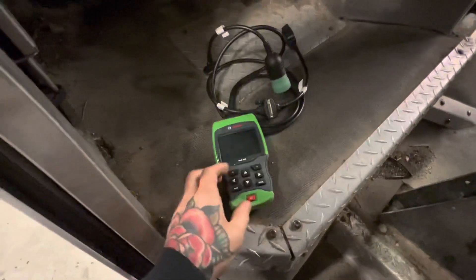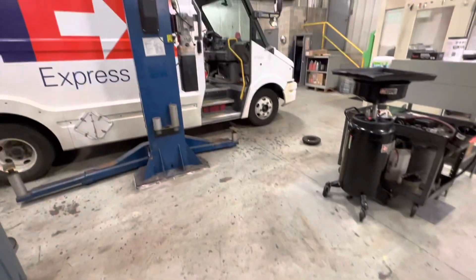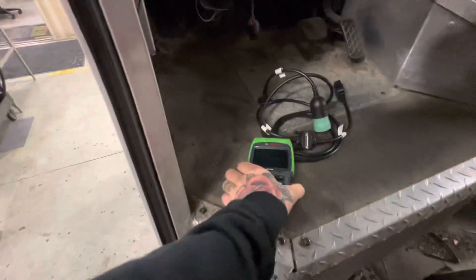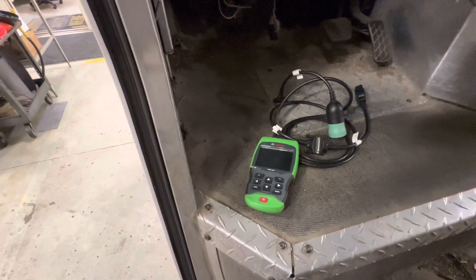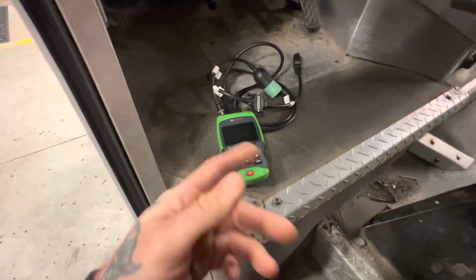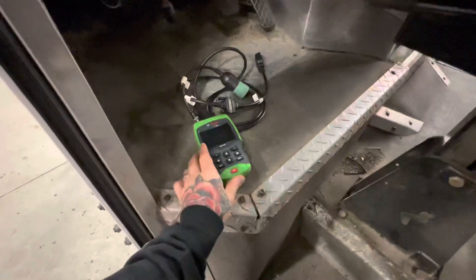It's not going to do everything — it's not going to do regens or give you everything you want — but what I like about this is on mornings like today, when I get here I only have a few hours to get a game plan for the day and pick what I'm going to pull out of service. This truck had an exhaust light on, and I was quickly able to use this tool to check it out and realize I'm going to have to pull it for service and order parts. I do have the factory tool for the Isuzu as well, but it's just more time-consuming to get out and scan, whereas with this I can quickly scan it, see what's in it, and get an idea of what's going on.